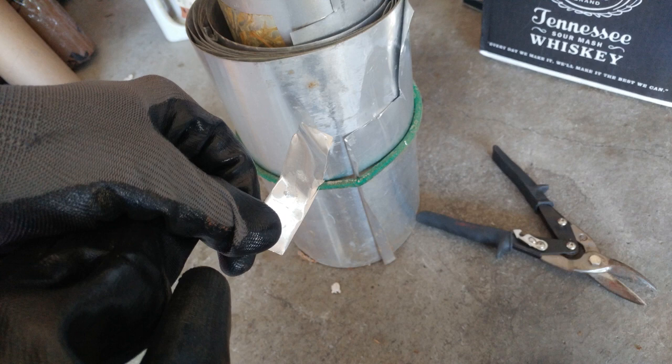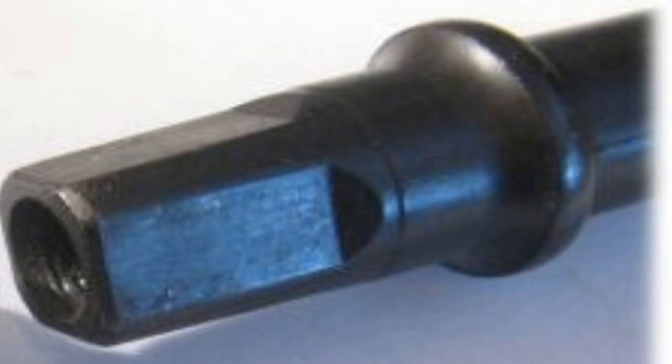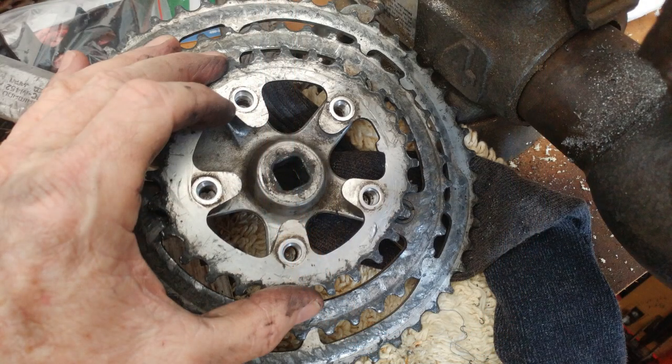I realized I needed to keep the pedal away from the magnet ring. The only way to do that was to shim the shaft, so I cut some flashing and made a shim. But as soon as I started pedaling — with 150 to 160 pounds of pressure — it compressed the flashing into tin foil and the pedal came loose. After two attempts the same thing kept happening. So my only option was to move the setup to the other side, where the triple ring sprockets are. On that side, there was over a quarter inch of space — more than enough for the magnet ring — and I'd never need to gear that far down with this powerful motor.